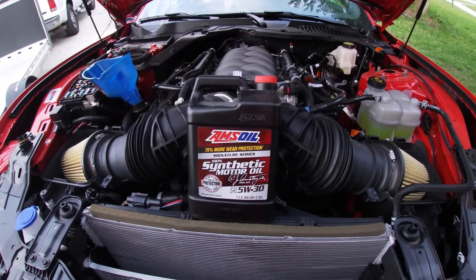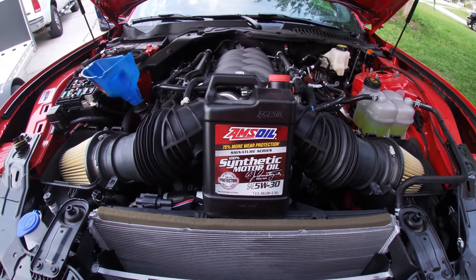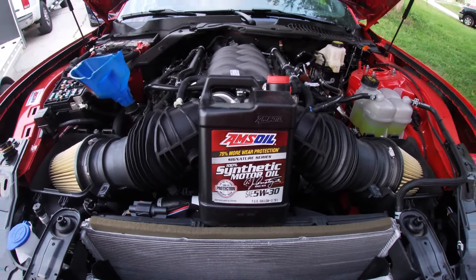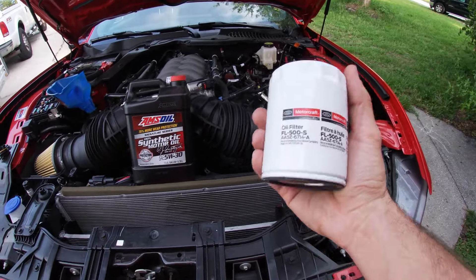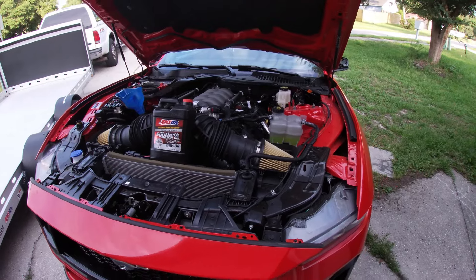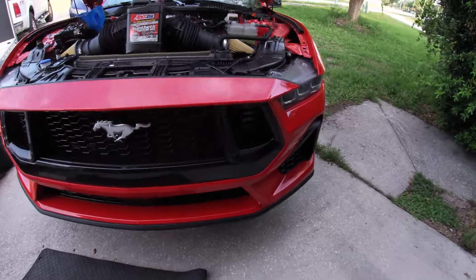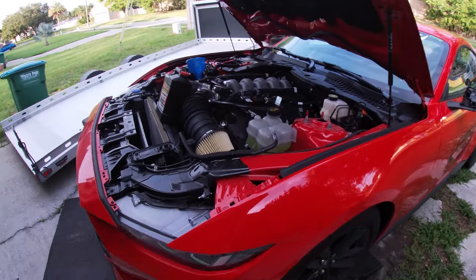Motorcraft is definitely not something I want to be pushing over 230 or 240 degrees, even stock or modified, so we're going to put the good stuff in. We're also going to be using an OEM filter — I have a surplus of these, so we're just throwing these on. This is just the GT. We're going to go ahead and drop the lower panel. It's held on by a bunch of screws. They got rid of the access panel that was on the previous gens, so now in order to do an oil change you have to remove this whole fabric-y splash shield to get to the filter. It's still in the same spot — not sure why Ford did that, but it is what it is.